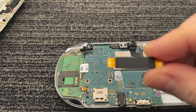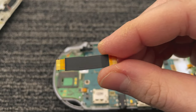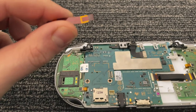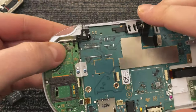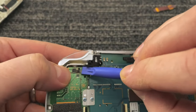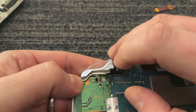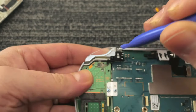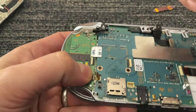So that brings us back to what I suspected the issue was in the first place — the ribbon looked like hell. Taking a look at this new ribbon, the contacts are good and everything's intact. We're going to try putting this one in now and see how that works. First I'm going to reconnect the other ribbons. It can be a little bit of a process, but you don't want to get too worked up and rush it — they can break pretty easily.